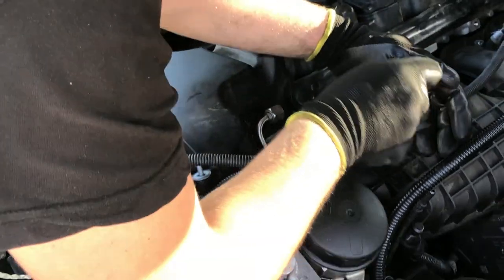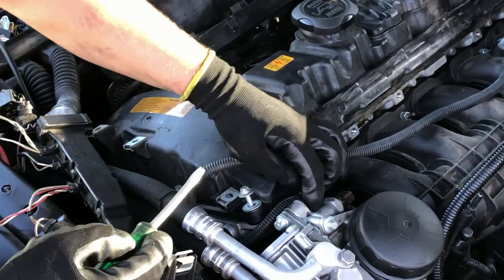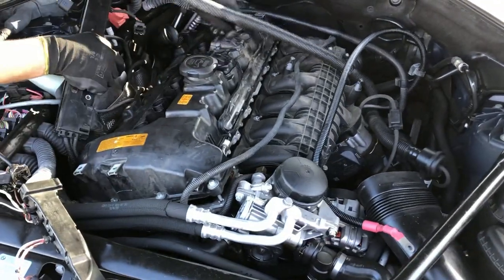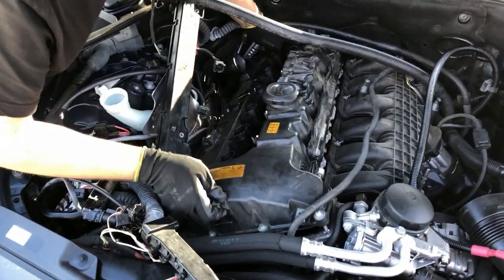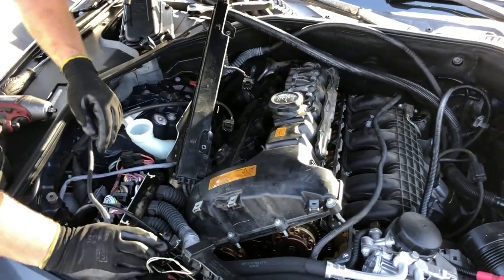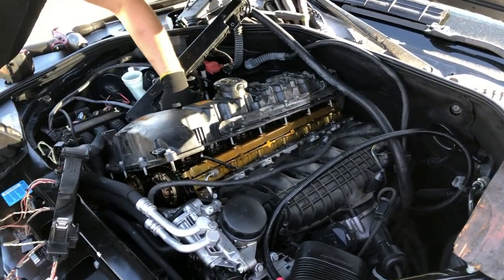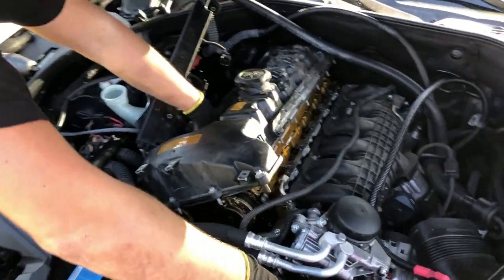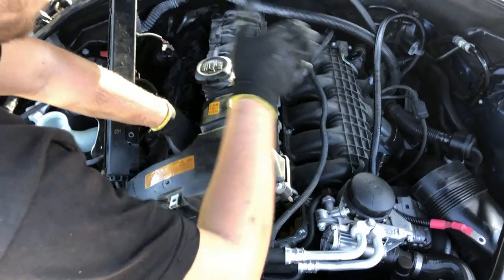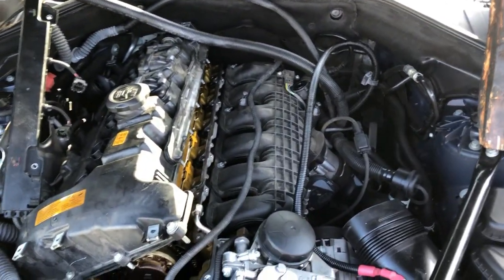Use a screwdriver slightly - push it under the gasket and move it a little bit. Work your way around all the edges slightly and eventually it's gonna come out. We worked our way around it and now we're ready to remove it. The aluminum spark plug tubes are in the way for the valve cover to move to the side, so we have to lift it further. The turbocharger pipe is also in the way, so we have to clear the way to the side.